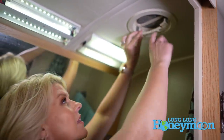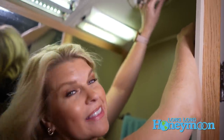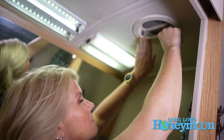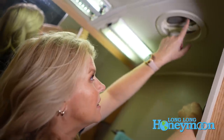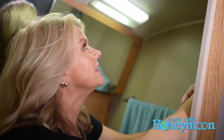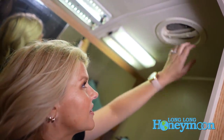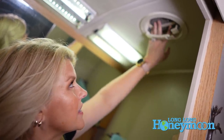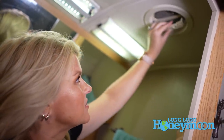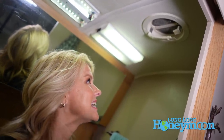One other item to check while you're in your bathroom is your bathroom vent exhaust fan. Our handle recently broke on ours so that's on our to-do list to fix. I'm going to pop it up — we also need to remove the screen and clean it really well. I'll pop on that exhaust fan and you can hear it's going strong — that's good news. The only thing we need to do is get a tiny screwdriver, remove the screen to clean it, and replace the handle. Nothing major but something that has to be fixed — that has failed inspection.